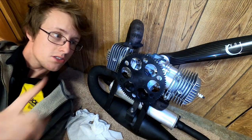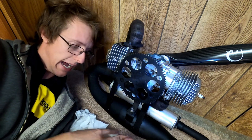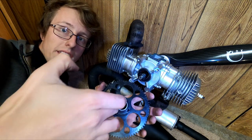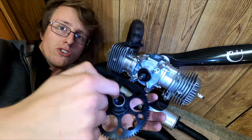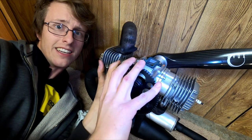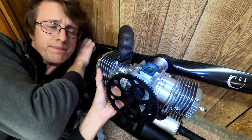Well, crap. So the bearing inside of here is fixed. Problem is I didn't do anything. I actually went to pack paper towels in the bottom of it. It's a trick I learned working on cars. You pack paper towels in there and then push with usually something like an extension or a screwdriver to shove the paper towels under the bearing to pull the bearing out. I wasn't able to do that, but then just for fun, slid it back on the engine and hey, guess what? It's working again. Couldn't tell you why, other than oil.